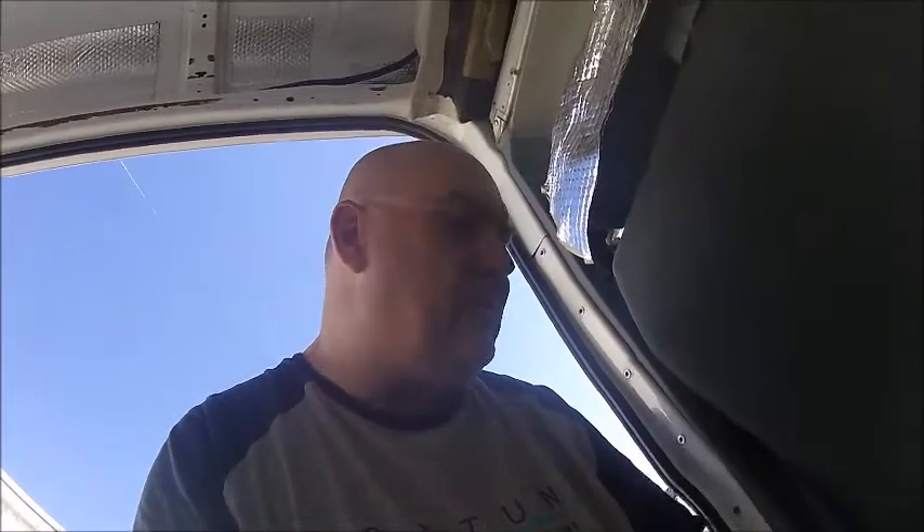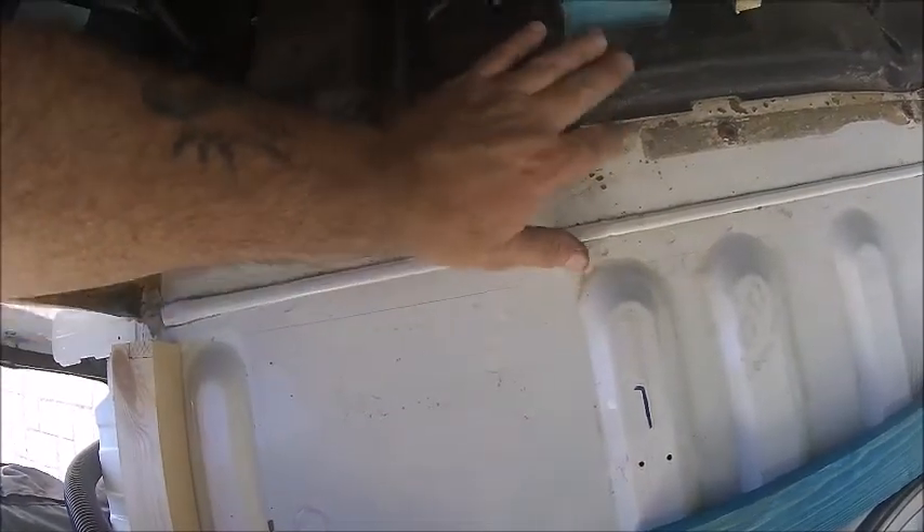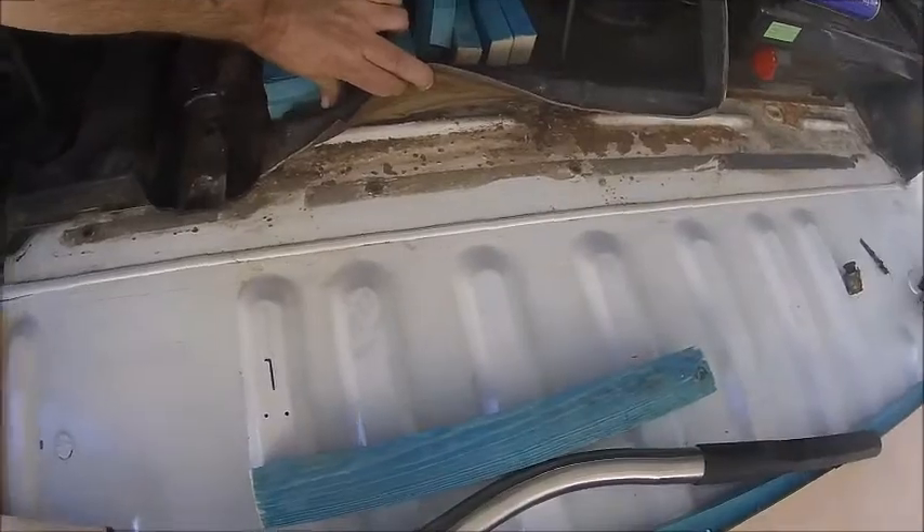I think I've opened up a can of worms. I'm just trying to get the floor finished — or start to get it finished. And where the back of the van meets the front cab, where I want to end the floor, I treat it as two separate things. There were a few spots of rust. Before I put a wooden timber down, I wanted to treat the rust and put some Hammerite on them — these bits here. So I started to delve a little bit deeper underneath, to hoover it all out and get rid of the dust. And then that's what I find — I think it's all the way underneath. More work.